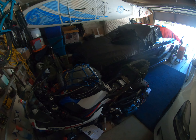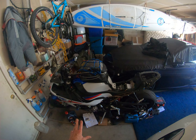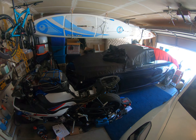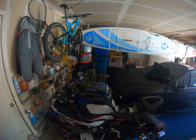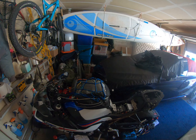We'll change the oil on this. And this is scheduled to go in for a tensioner — a spring tensioner. It's a recalled item on this bike. If you're revving up over 10,000 RPM, that spring can fail. So it's something they're going to replace for me. It's scheduled to go into BMW next Saturday, one week from today.